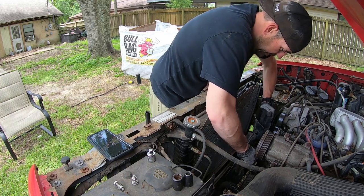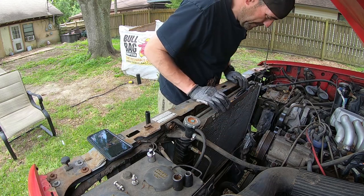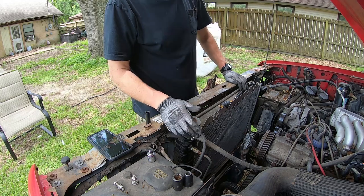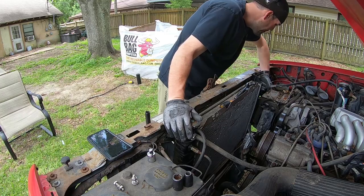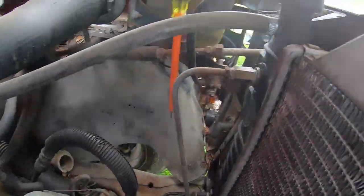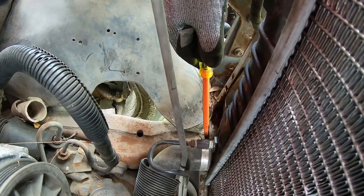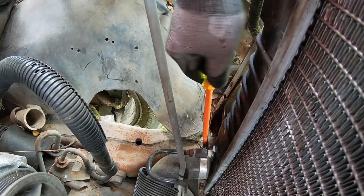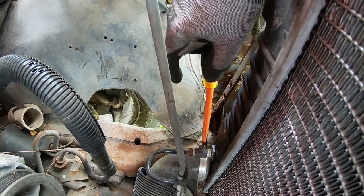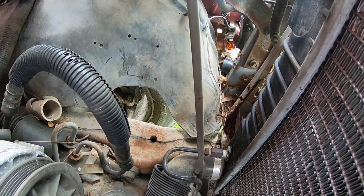I assess here how I'm going to attack this next job. I'm looking at the fan, wanting to remove it, but I know the core support is the most important thing today. So - radiator, condenser, and I guess that would be the transmission cooler - still there, we're ready to get this done. We're just going to go ahead and look at these cooler lines that we're going to need to remove. We're going to have to put two wrenches on there so we don't twist any lines. We're going to undo that line right there - actually what I'm doing is undoing the lower radiator hose.